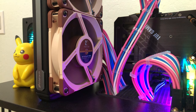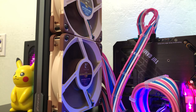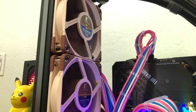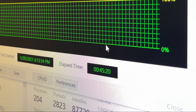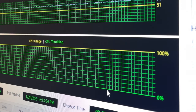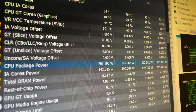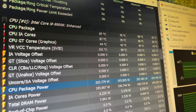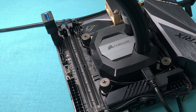The only difference between this setup and last year's setup is the radiator fans. I replaced the two Corsair HD120 RGB fans with Noctua NF-A12x25 fans for better cooling performance. I ran AIDA64 for 45 minutes to test and there was no CPU throttle — the same test I did exactly one year ago. According to HWiNFO64, the CPU pulls around 200 watts. With a room temperature of 23 degrees, the average CPU package temperature is 82 degrees and max is 90 degrees — exactly the same numbers as before.